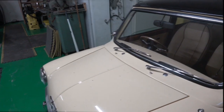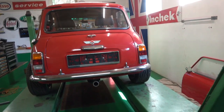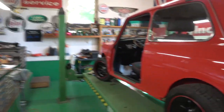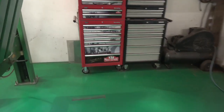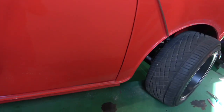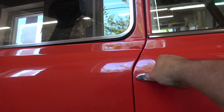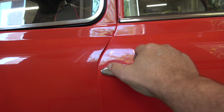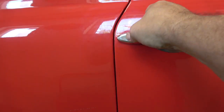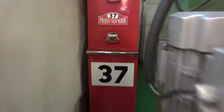We'll take you on to repairing these hinges — hopefully a few tips will help. One of the complaints the inspector had was about the door hinges. There was a tiny bit of movement in there, so we've taken them out. This one we've replaced the other side. You can see the door is good — the shut lines are nice. When I open it, it's not jumping up and down. It opens really easily, with nice shut lines all the way along. That one's done.